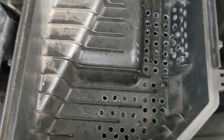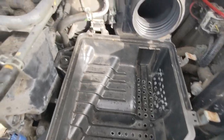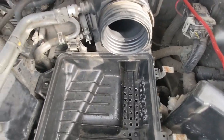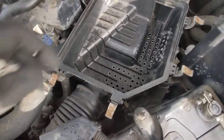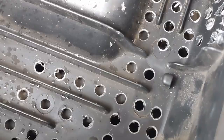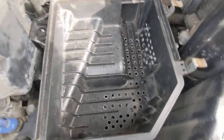Just a quick one. What I've done — I've drilled some holes in my FK2 airbox just now. This was a right pain to get out and I don't recommend doing it with the airbox in the car, because as you can see through it, there are some things in your way. So I took it out, put it on top of a cardboard box and started drilling some holes.